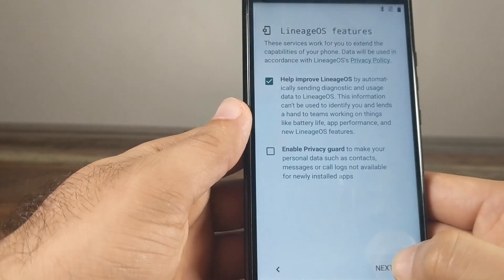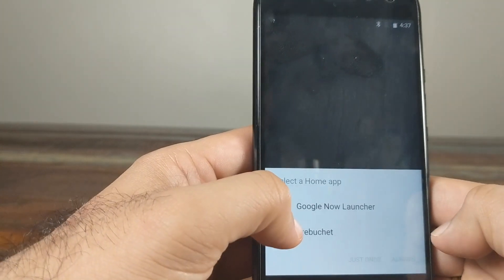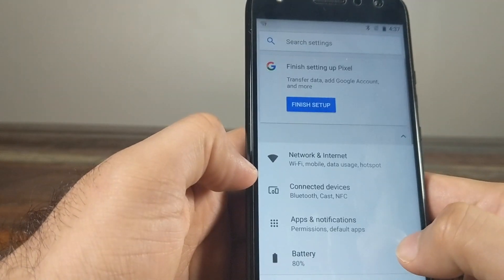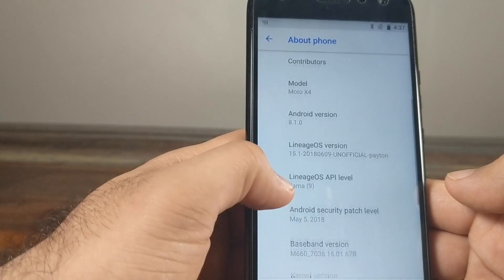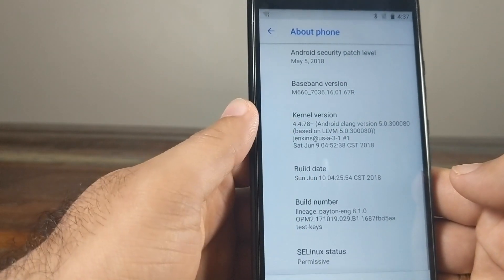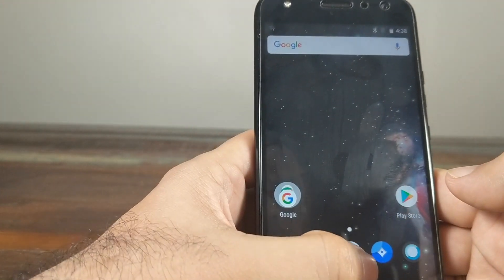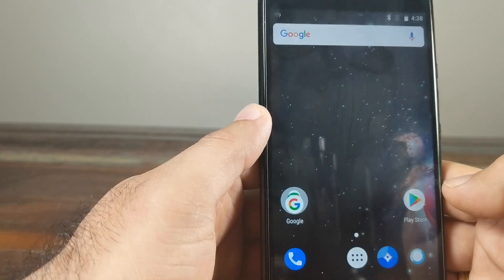Click Start and skip through the setup. If you see flashes of a red rectangle on the side, that's because this is an engineering build with some known issues with user debug builds. GApps were installed properly — you have the option of Google Now Launcher. Select it, and on the home screen you have the Play Store. In Settings > System > About Moto X4: Android version 8.1.0, LineageOS built yesterday, security patch from May 5th, SE Linux is permissive. To root, boot back into TWRP recovery and install SuperSU or Magisk. That's how you install LineageOS on your Moto X4 — share the video and subscribe!